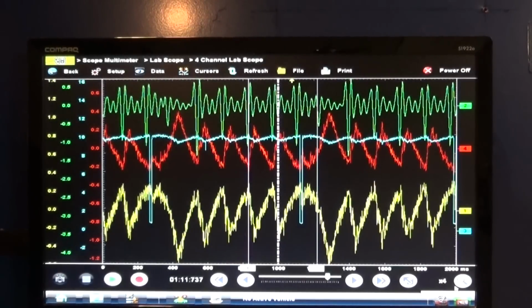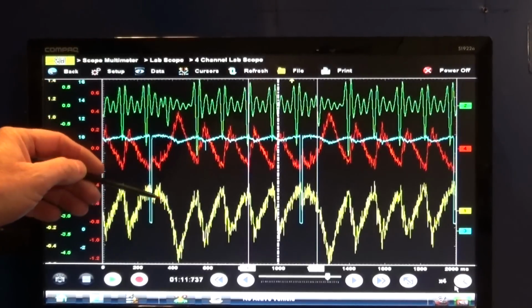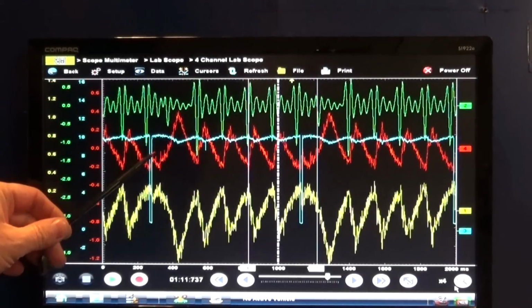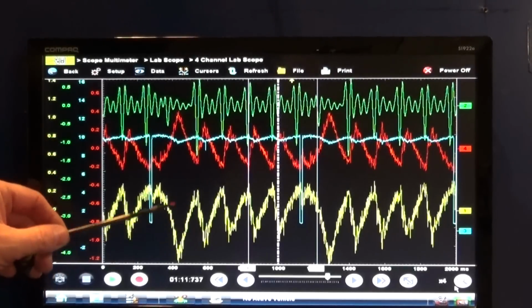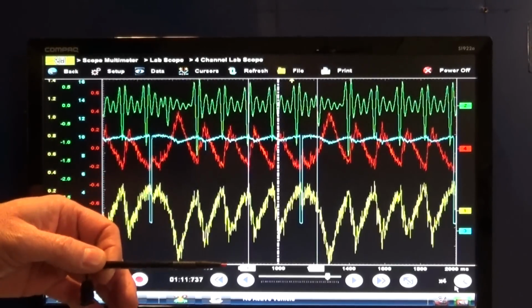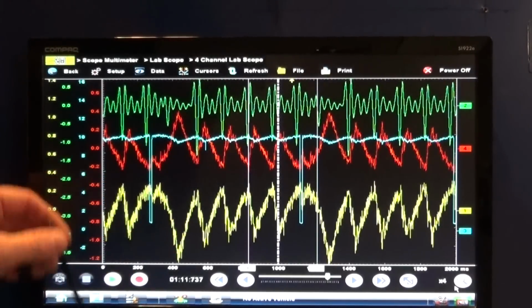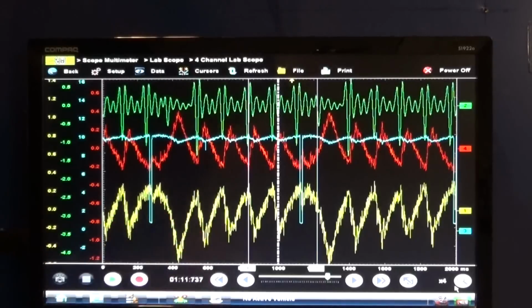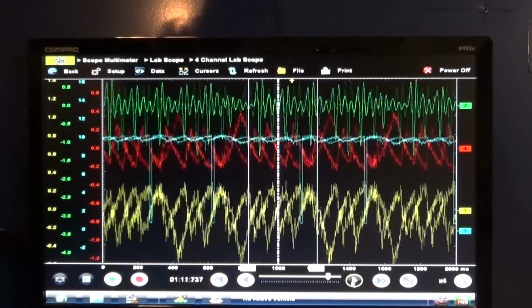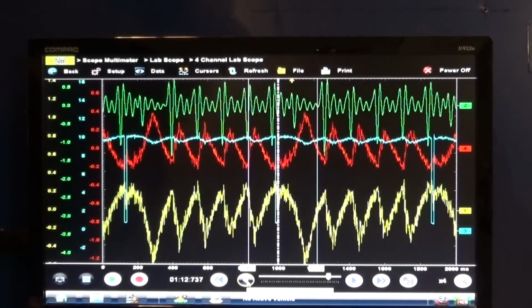All right, so we can see now, as I said the first time, this is my misfiring cylinder. This is number two, now number three, and the current is a little higher, because I think as the engine slows down, it needs more current to keep it going, to get it back to the speed where it used to be. So this can be a little deceiving as well. You can see the higher current on the following cylinder. It's pretty much the same, because the engine slows down and then it needs a little more current to keep it turning.